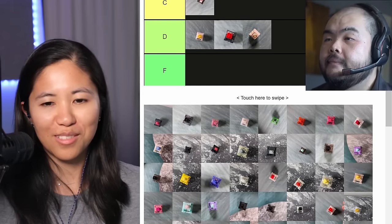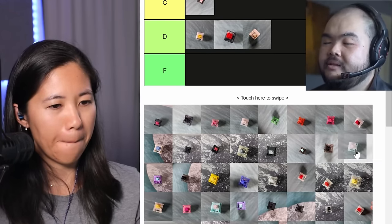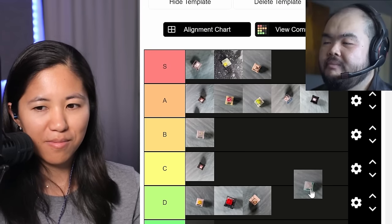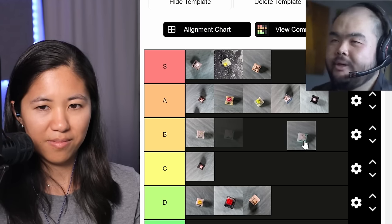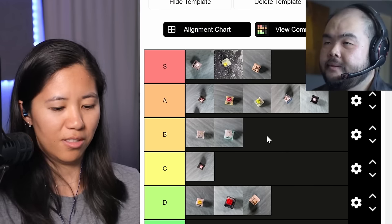This one's pretty. I think this is a Texie. Yeah, that's a Jadeite or Diamond — they're the same switch, just two names. It has a UPE stem and UPE top. The stem might have a little more stem wobble because it's pure UPE — yes, definitely some movement there. It looks very pretty. It needs a little love but it feels smooth, very smooth. The ones where it's in between are very hard to rank because they all sound and feel great. Probably a solid B tier — smooth and can be used pretty well stock, but you might need to lube the spring. The stem wobble is pretty intense. B tier it is.